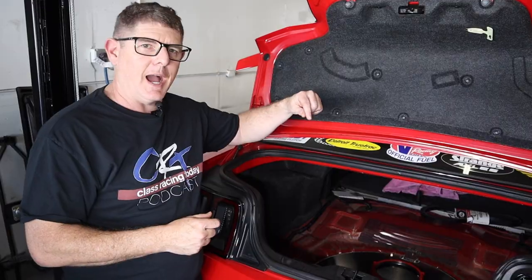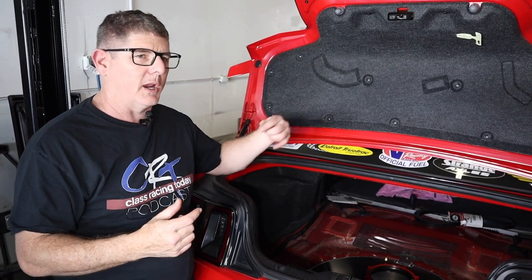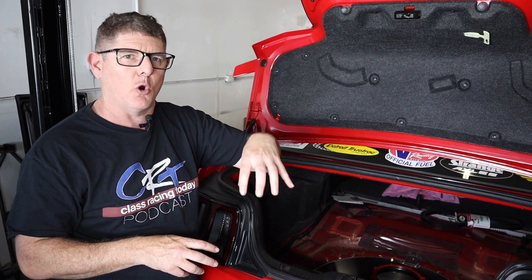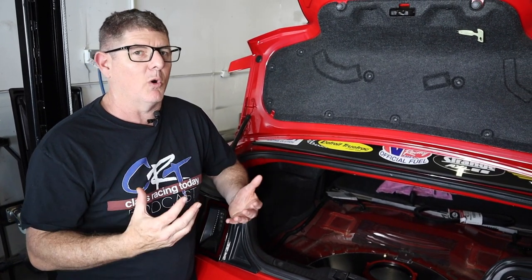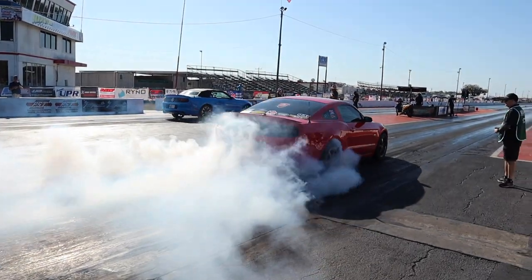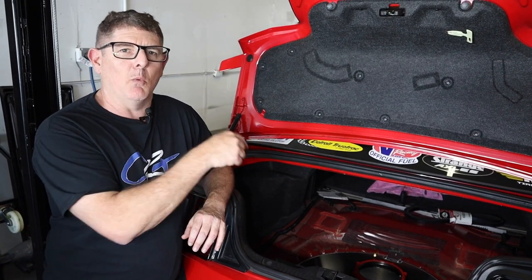You can kind of see how good it looks in there. What are we going to do with this tank? Well, we're going to fill it with ice water, because that's what the intended use is. Running ice water allows you to circulate ice-cold water through the intercooler, as opposed to just ambient temperature or slightly chilled water that goes through the heat exchanger. When you've got ice water going through and cooling that intercooler, the intake charge that's just been compressed by the blower is going to go through that ice-cold intercooler, and it's going to give you a denser charge in the cylinder. If you've got a denser charge, it means you have more oxygen, and that means you can burn more fuel and make more horsepower. On a supercharged engine, that's especially important because you can get away with a little bit more timing, and if you can get away with more timing, you're going to make even more power. So hopefully this thing will go quicker on track and we'll pick up a few horsepower by way of ice.